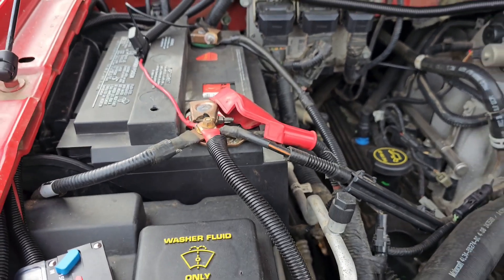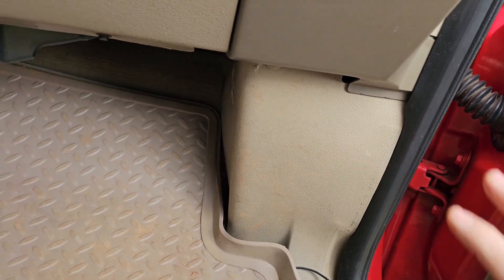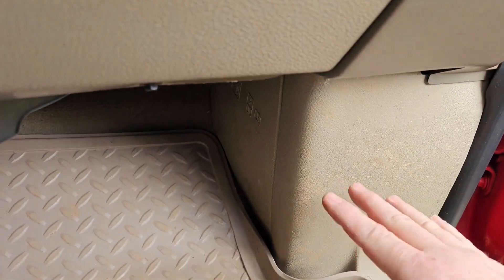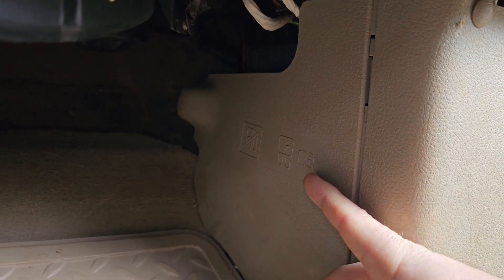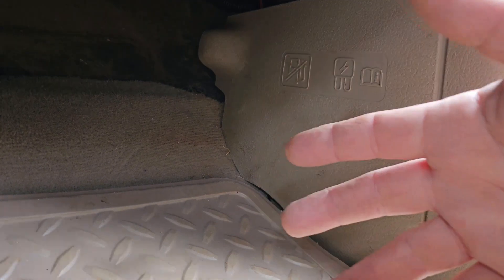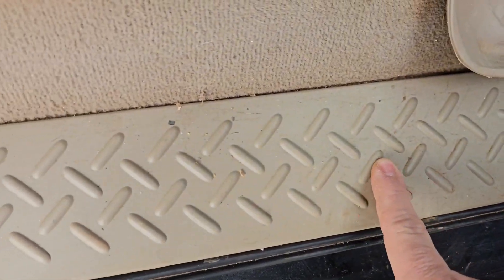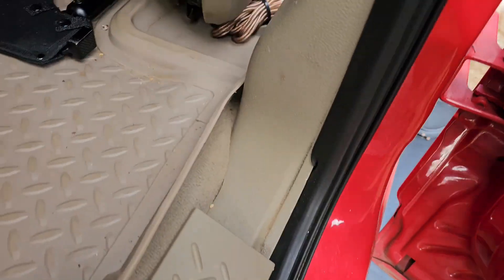You'll take off this panel — it's a process but it's specific to this truck; it'll be different for every vehicle. If you have one of these model trucks, this is your fuse panel — it just pops right off. Then you can pull it back a little bit, and up in there is where that rubber grommet is, which is why you need the coat hanger. Long story short, this isn't a full installation video — just showing how to do it for this vehicle and why you should do it.